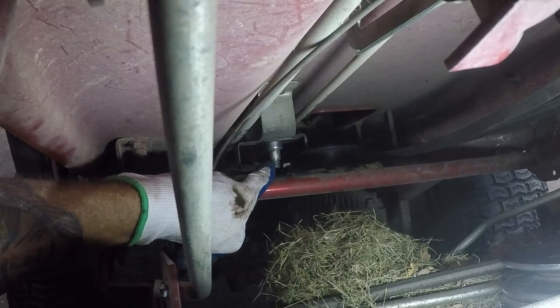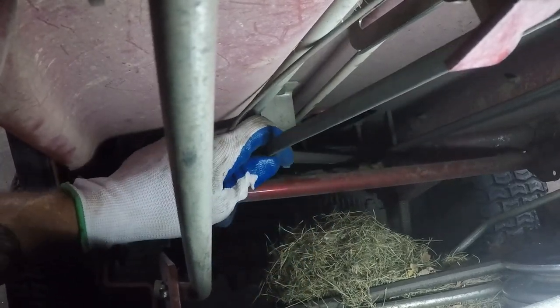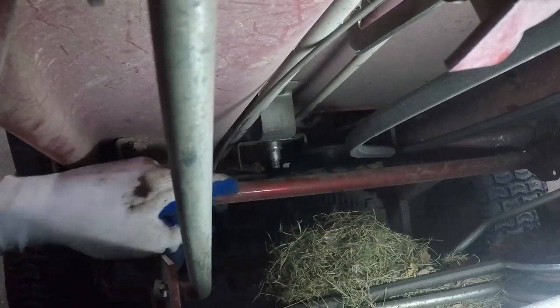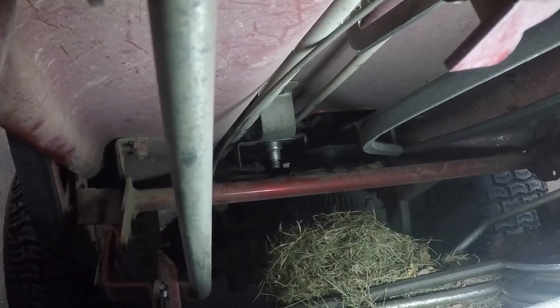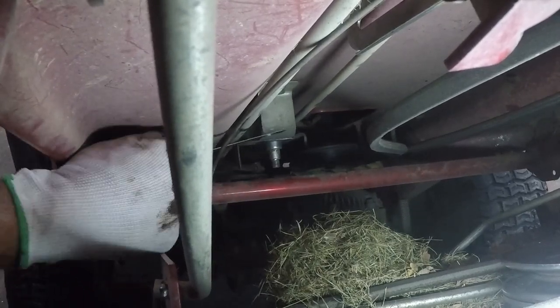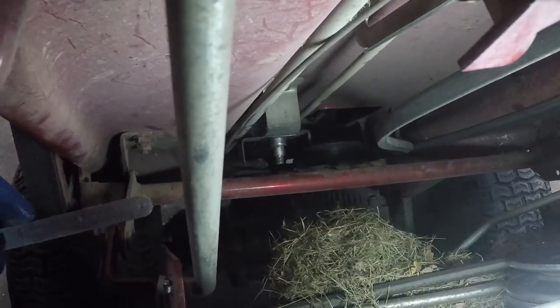But, all right, now it's time to figure out. I can only assume, once I depress the clutch, that that would need to be a V-type pulley, and it's not a very large diameter one. So I'm going to measure across here real quick, and we'll see what we have in the way of distance. I'm really organized today. There it is. I knew I had a little... Ouch! That hurt. A little machinist scale here. Looks like a 2.5-inch, possibly a 3-inch pulley. So if I can hold my tongue right and get that down there to get a measurement. Oh, my hand's going to be in the way. You guys aren't going to be able to see it, but I'll let you know what it is.